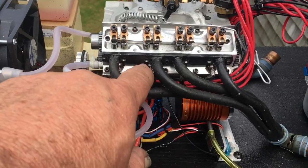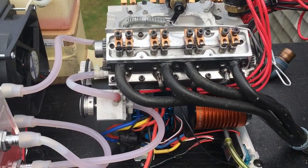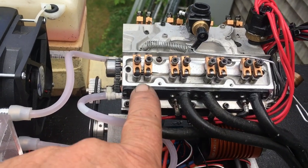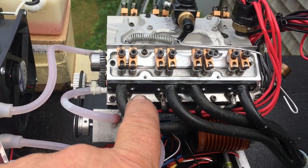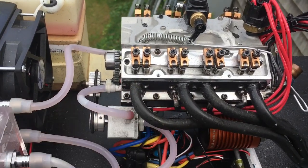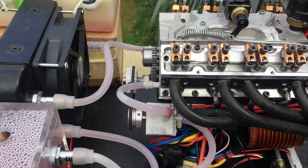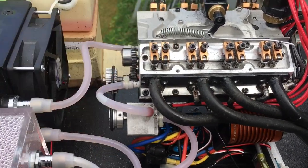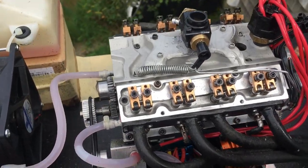The other really important thing is glow plugs. You have to watch what glow plugs you use. If you're going to do one of these engines, I would highly suggest before you put it together, get your glow plugs and make sure they don't bottom out on the valves — because that's what was happening with me. I added two copper washers per glow plug, which pulled the plug back away from the valve so it didn't push the valve off its seat.